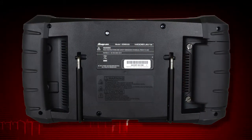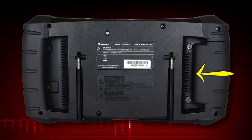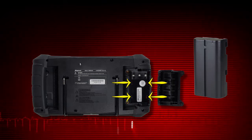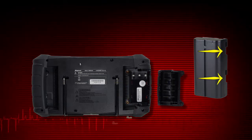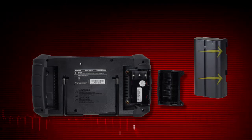To install the battery pack, loosen the two screws that retain the battery compartment cover, then pull on the inner edge of the cover and lift. Align the tabs on the sides of the battery compartment with the slots on the new battery, then slide the battery up to lock into place.